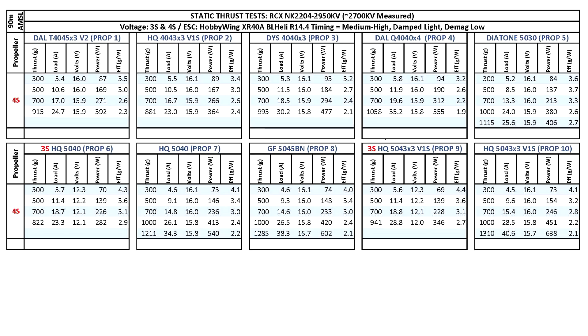Overall a very good motor. You can compare these results to the 2400KV version I tested a few months ago. When I tested that motor, I mentioned to RCX that it would be a good idea to make a higher KV version. As you saw from the teardown, it's a very well-built motor — pretty sturdy with a 4mm shaft — and people have been saying they do like this 2204 motor. I also got the 2700KV version, so I'll be testing that one soon — keep an eye out for that.